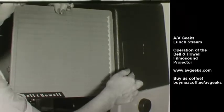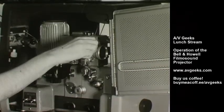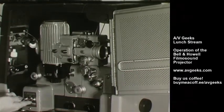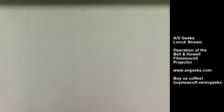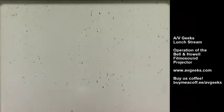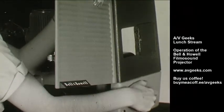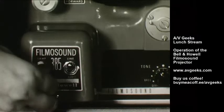Open the small door in front of the projector lens, then turn the clutch control clockwise as far as possible. When the power line and lamp switches are turned on, a beam of light is projected onto the screen. The light image may be focused by rotating the lens. The image may be centered by adjusting the tilt knob at the front of the projector. Moving the projector forward or backward may be necessary to fill the screen with the image. Turn the lamp switch off and the power line switch off.